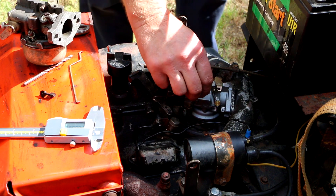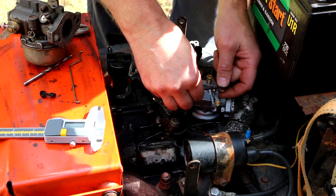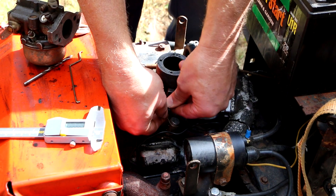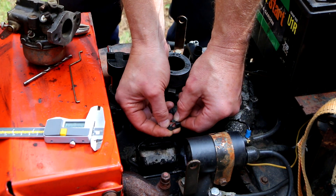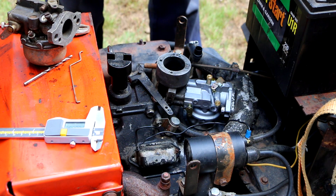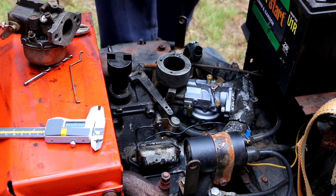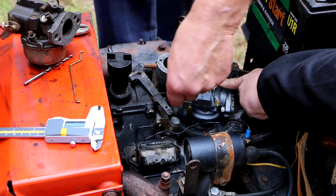Actually it feels fine. I bet when I first tried it the piece I had on there was a little squashed down from cutting it with the cutters. This goes in from the bottom - it sticks down in here like this. So that's where it's tight - it's tight in this plastic thing, which is a problem. It takes a little more effort, so I'm gonna try and run this drill bit down by hand to ream out a little bit of plastic without damaging it too much. Did it - cool. There you go, should work now. I have to get this side in first.